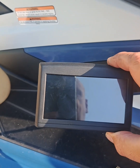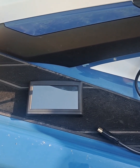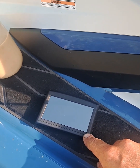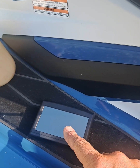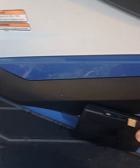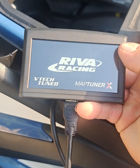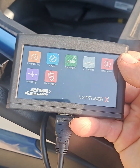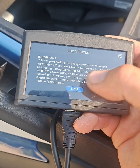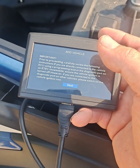I bought this used, but you have to go on Riva's website and buy a license. Once you buy the license, you go on Riva's website on a laptop, hook this device to the computer, and download the license onto it. But first, you've got to hook this up to the ski — it'll turn on by itself once everything is connected. Then you hit 'Add a Vehicle,' hit next through the prompts, and it will automatically read your ECU and get all the data off of it.